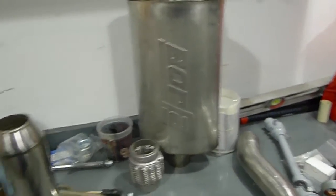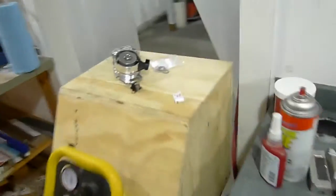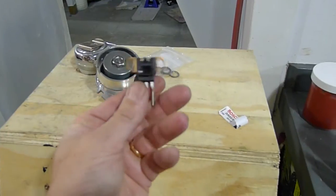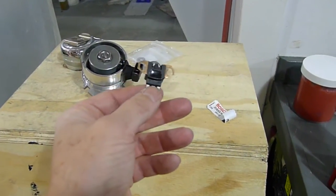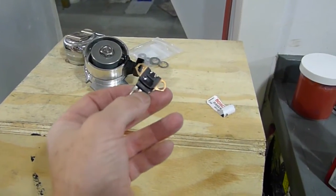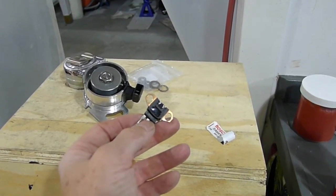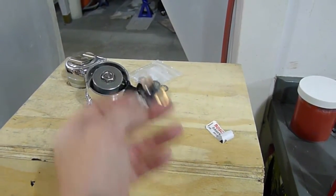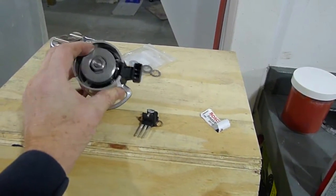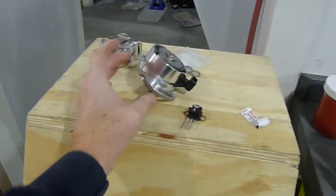I'll be able to weld up all this exhaust stuff this weekend. I had to take this apart because I was damaging the Hall Effect sensor. Until I pulled this thing all apart, I found out there's plus and minus for the power supply, and the output is an open collector, which means you need a resistor. Tie the resistor to high — to the 12 volts — and then it'll pull down; otherwise it floats. So I bought a new one, clearanced it, it's all toleranced and set up, and it's ready to bolt on the engine now.